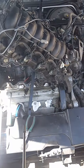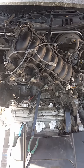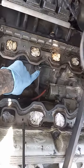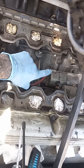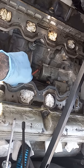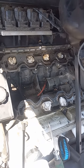We're doing a new gasket — they actually say you can reuse the original, but we're not. We're putting a new one in. You've got the knock sensor in there too; it's suggested you change that. This one looks new, which is why I think the starter was already a replacement — because of the missing nut. Somebody just forgot it.